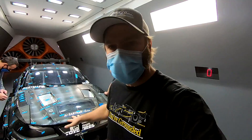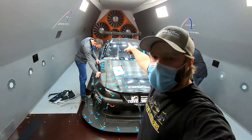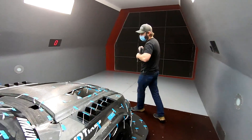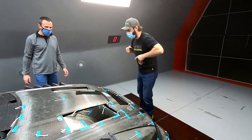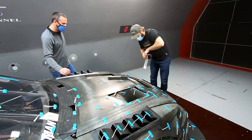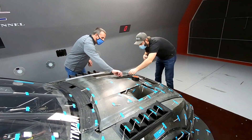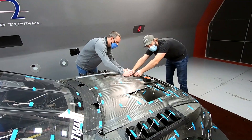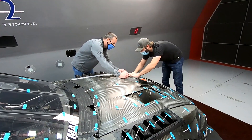We're getting my car back to the front-end trim that I race with. We're going to hop into the rear and do all the aero changes back there. We're making more front downforce than before, and we're going to put our little gurneys back on in front of the radiator to see what they do.